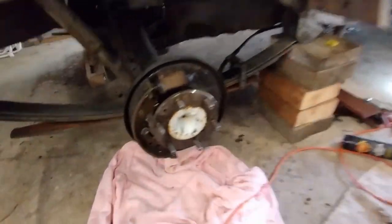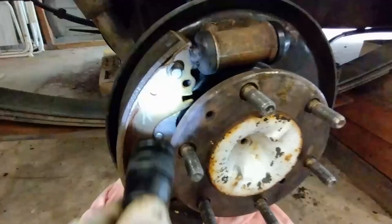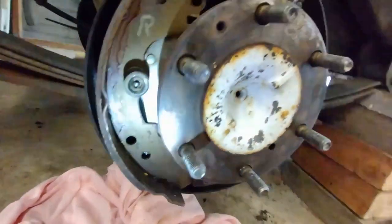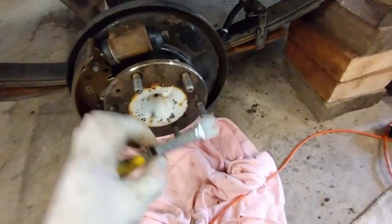At this point I've gone under the car and put a little bit of tension on the handbrake. The rear shoe is installed — that's sitting in the top there and the bottom holder. The clip is in place and there's a little bit of tension on the rear brake. The spring goes onto the arm there at the back, comes through, and that spring connects there. For the right-hand shoe I have to put this spacer in and get the spring on, which is not easy.